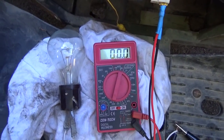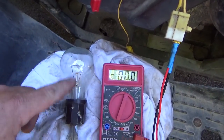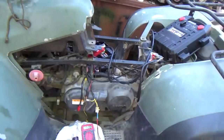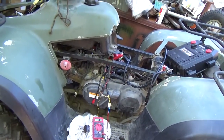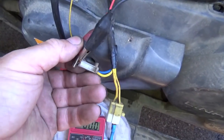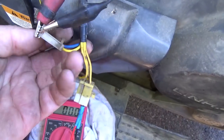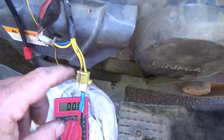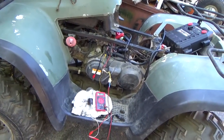Welcome back for another adventure. We're going to use an ordinary 60-watt light bulb and one of these cheap meters to determine if the stator is any good on this thing. It has all kinds of electrical problems and I'm trying to figure out what's good and what's bad. We've already determined that the pulse generator is good because we managed to get this thing to start. So the next thing we need to do is figure out if the stator is any good, and from there we can build an electrical system that now charges the battery.